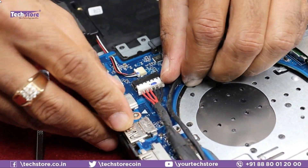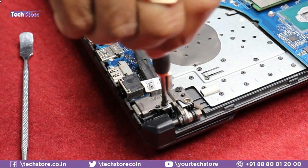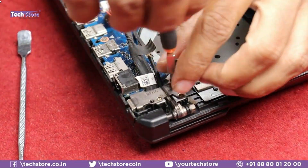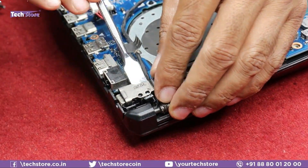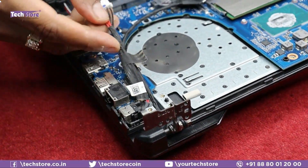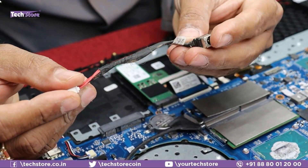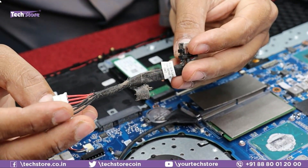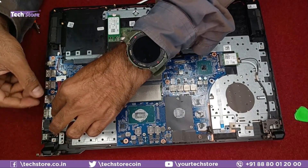For people who want to replace the DC jack: remove this particular jack. Remove the screws held on by the hinges and pull it out. The DC jack can go bad over time — replacing it will restore power to the laptop. This is the DC jack you need to replace it with. Put it back once done.